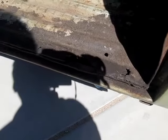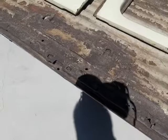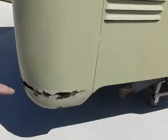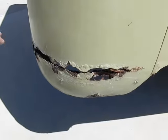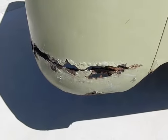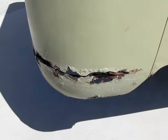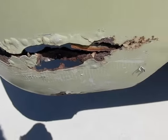As you can see, the floors are rotted out — they got damaged on the edges and all around inside, so we're going to change all the floors like we typically do. This area here is the rear corners. On the other side of this corner is where the battery sits on the passenger side. This is very typical — moisture gets into these buses, the acid from the battery sits in the battery tray and rots the battery tray and the whole corner, as you can see, completely through.